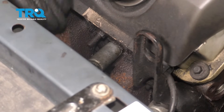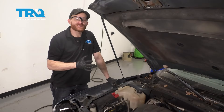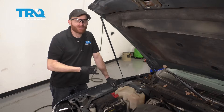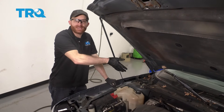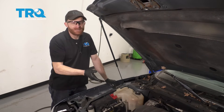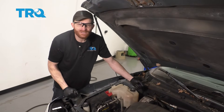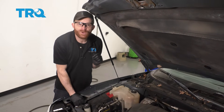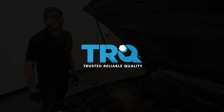You don't want this shaking around and falling off while you're driving down the road. Okay friends, we got one of our spark plugs in there. The process is gonna be the exact same thing for all the other spark plugs. The ones along the back of the engine are a little harder to get to, like I mentioned — just carefully reach along the back of the non-running engine, pull off the wire, do one spark plug at a time, and put the wire back on. Thanks for watching.